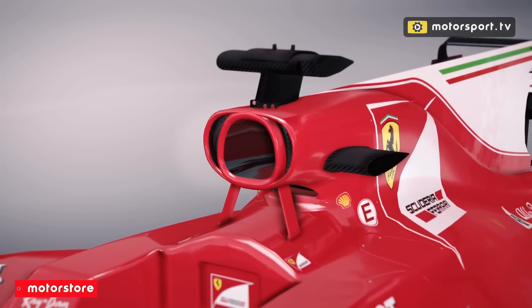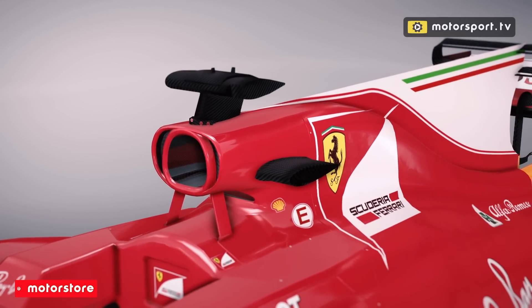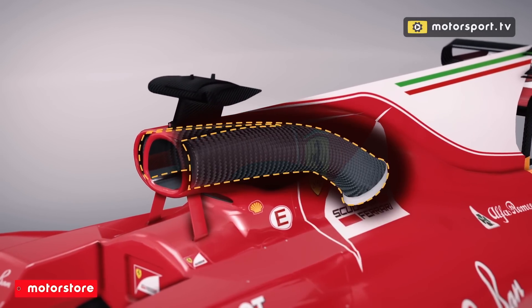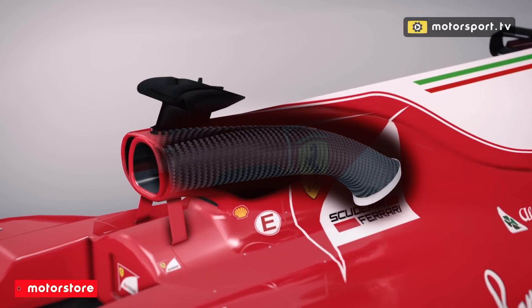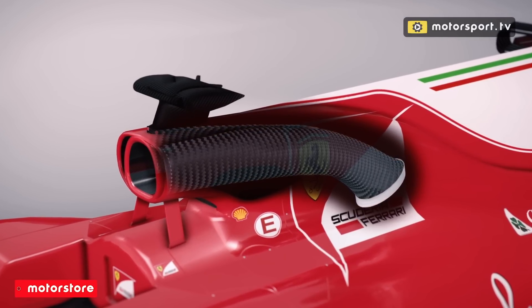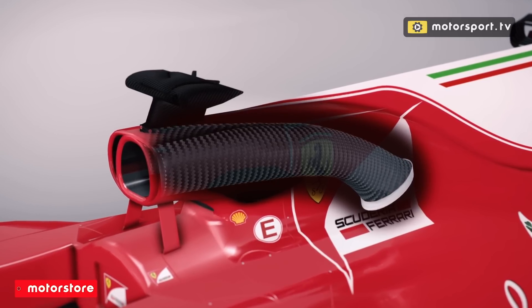You can see where these ducts are going and what they're doing. Each of these ducts feeds back into a common duct, and you can see each side joins up and then feeds down to a cooler mounted right at the back of the engine. Now, there wasn't a cooler there before. There's an oil tank tucked down around there, but the actual space at the very back of the engine cover was all empty — absolutely ripe for sticking a big radiator in there.